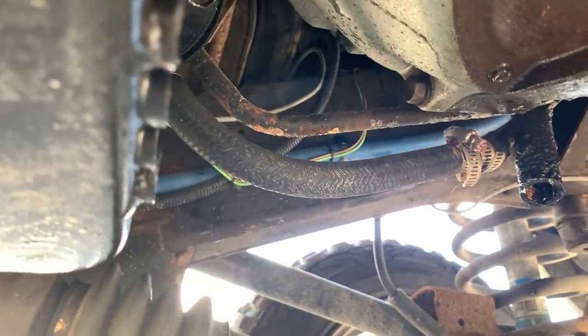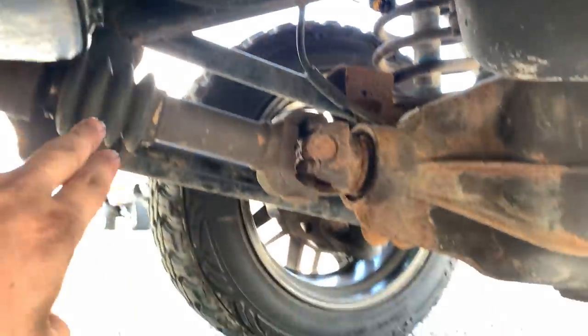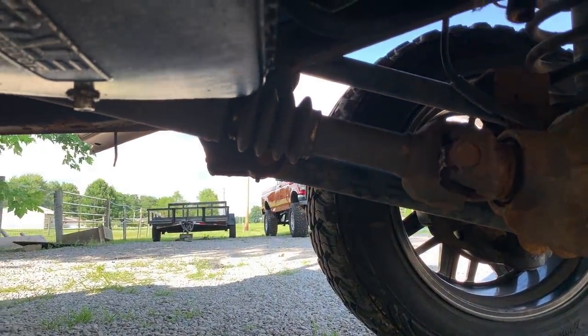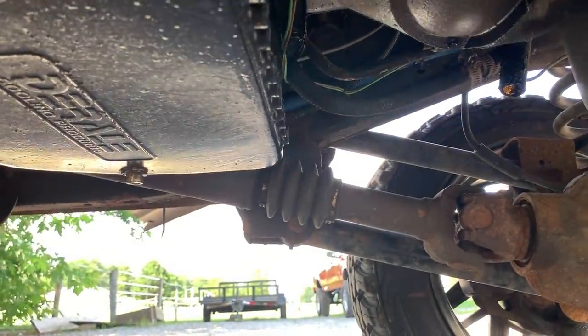You can see those wires, the brown and the green. You go straight up into the engine bay. I mean, they're fished out of the way of moving parts. So you can't have a bunch of slack and then your wires end up rubbing on your drive shaft, or they get caught up in your column shifter or whatever. Anything that moves, make sure it's not touching.